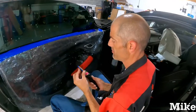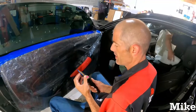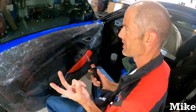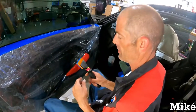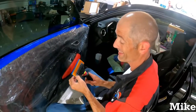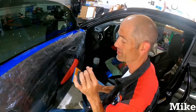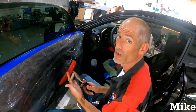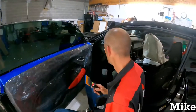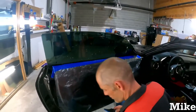And we actually really dig these hybrid blades. Hybrid blades, special on back windows, y'all. Use a softer one for your second squeegee. You got to use your pink or your yellow first. Come back with this, and it goes right around the defroster lines. It takes out just enough water, and then flip it around and hit it with a blue. Like perfect. Mustang back windows, Chargers, all that kind of garbage. Yeah. It helps. Do yourself a favor and do it.